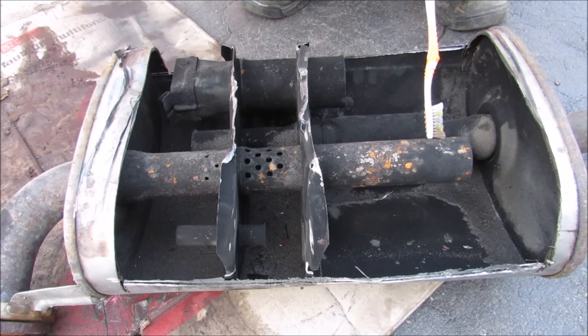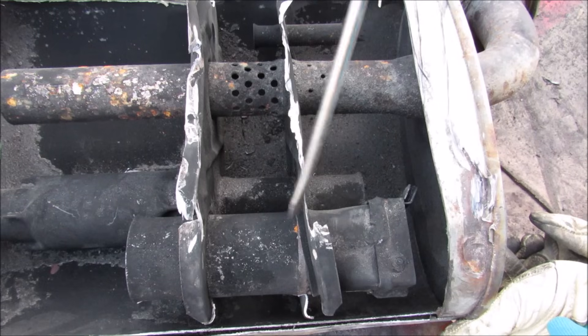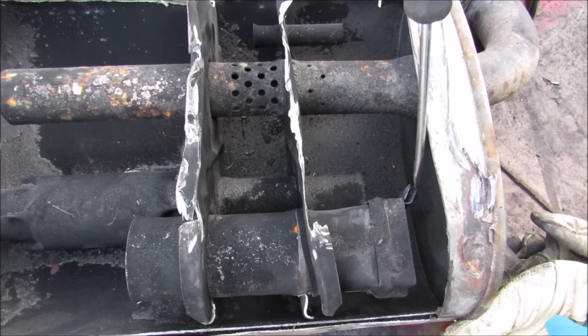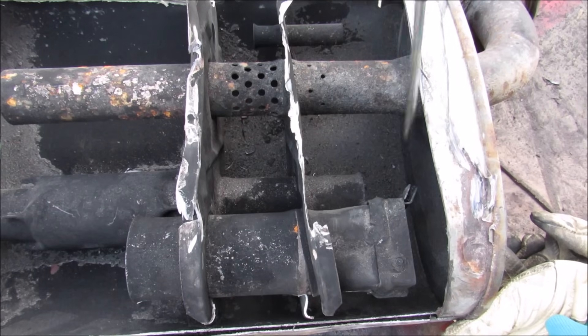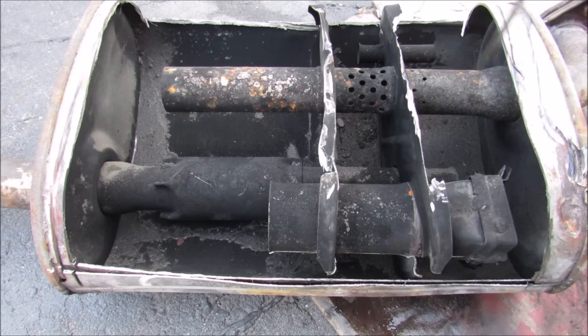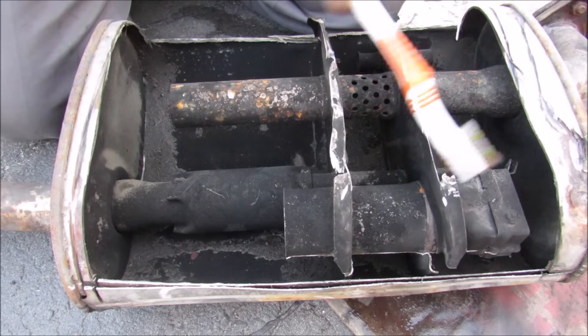Once the third chamber has built up some pressure, most of the exhaust gases will flow back over here into the first chamber. But this muffler is not that simple — we've got this little spring door here in the last chamber that only opens up when a certain amount of back pressure pushes it open. What that does is allow the remaining exhaust gases and sound to enter this third chamber. Any remaining sound waves will bounce off of these two walls — the front wall of the muffler as well as this baffle here. Any remaining exhaust gases through a high-flow situation will exit the exhaust pipe over here, head through the second baffle and the first baffle and out the tailpipe.